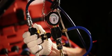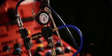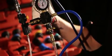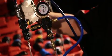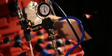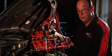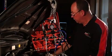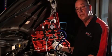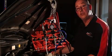I'll turn on the shop air and open this valve here. You can see the air coming out of the system here. Our vacuum gauge is coming up — once it gets up into the yellow section, we've evacuated most of the air out of the system. The beauty of this is it'll get rid of any air pockets we might have. You will notice that in most cases your radiator hoses will collapse, and that's purely because you're pulling all the air out of the system. You actually want to see that happen.